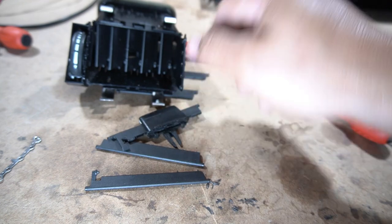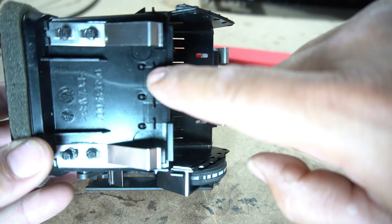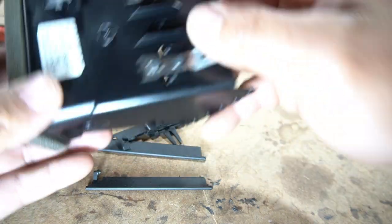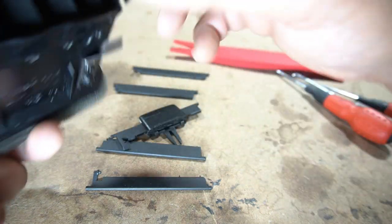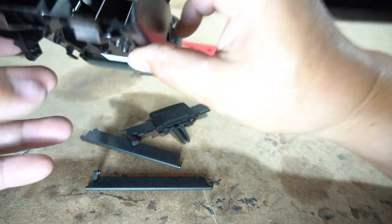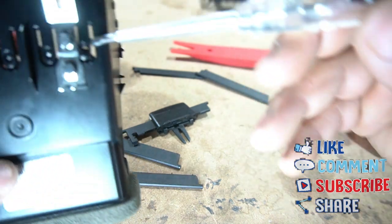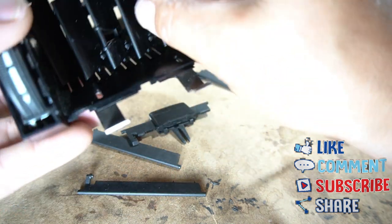If you had to remove the rear louvers, it's basically the same process. You see these circular tabs — there are five across the top and another five at the bottom. You just have to unclip them the same way you unclip the horizontal ones. All you do is pry it apart. For instance here I'm just going to pry this one up — and it loosens it. If you do that for all of them, the louvers will simply slide out.